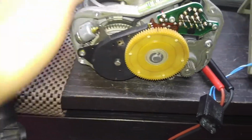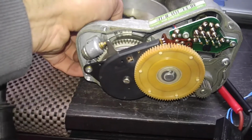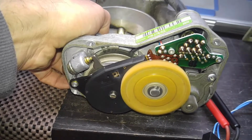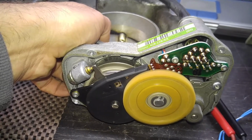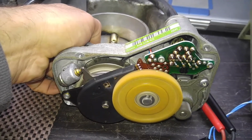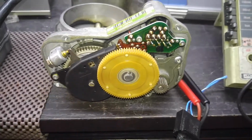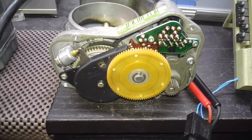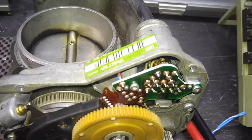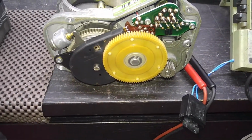I see it, and the unit, as you can hear, is still buzzing, making a little bit of a buzzing noise. But because the coil is not holding, I'm moving the plate, and with vacuum being drawn, we have the screeching noise. This is pretty amazing stuff, because usually it doesn't work like this. But in this case, somehow it got into this very bizarre mode where it's semi-energized. So this is very, very strange, but it is definitely a clutch coil issue.